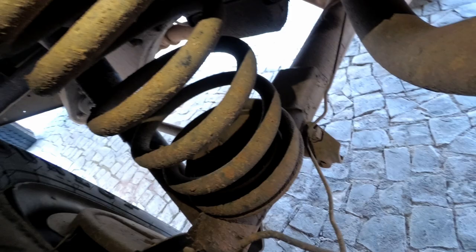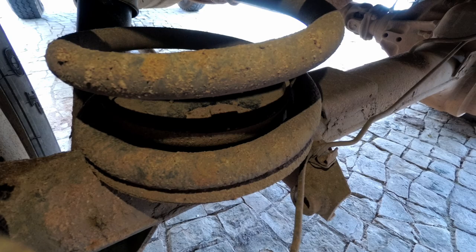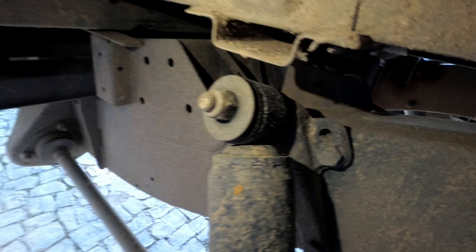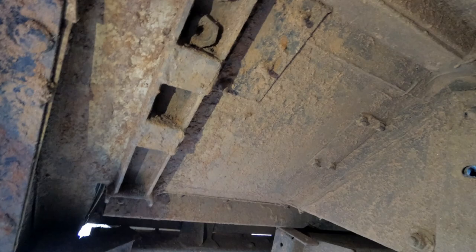Still got the backing plate on the brake disc. Springs look good. This one had helper springs because it's got the cup in the bottom - see the cup in the bottom - but they've been taken out. Shock absorbers are there - at least the washers are put on the right way around. There's a bit of a dent here and a bit of corrosion, but it's just at bay.